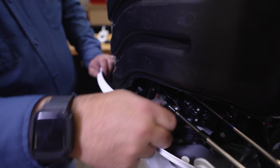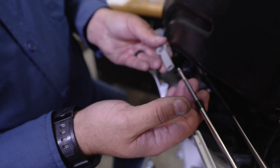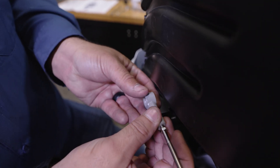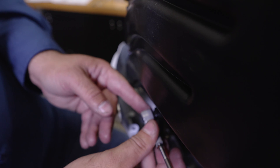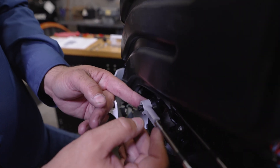Move the shift arm on the engine to forward, neutral, reverse, and then back to neutral. The multifunction tiller handle installation requires cable joints that are supplied in the outboard motor box. Screw the cable joints to the cable ends of the throttle and shift cables by approximately 0.39 inches or 10 millimeters, the equivalent of 9 threads.